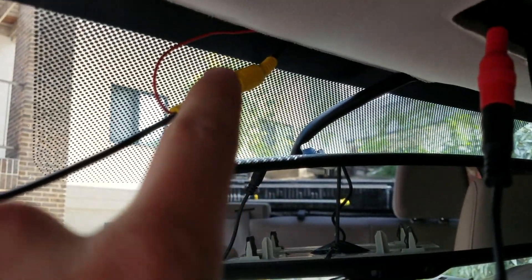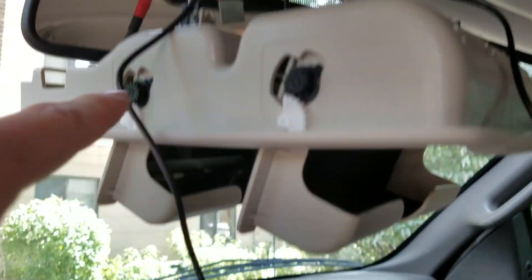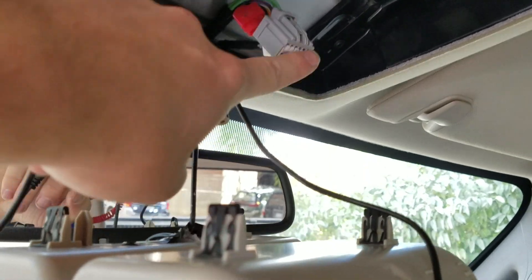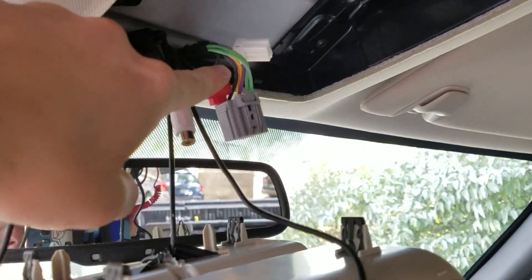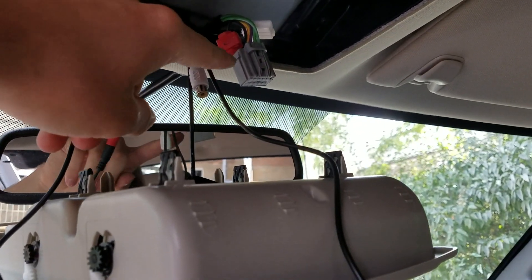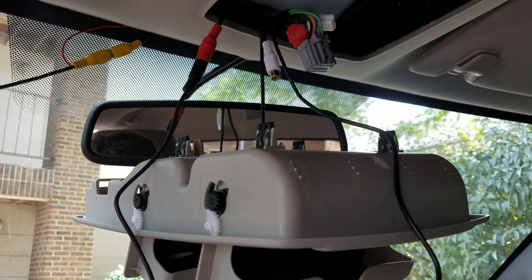Just a quick recap: we have the video output connected, the power is over here and connected through to the screen. We have the grounded connector with the black wire. This is for an extra piece like if you had a rear sliding door or a sunroof, but I don't have any of that. I could have found power with that and powered the unit, but it wouldn't turn on and off with the reverse lights — so that's why I use the reverse lights instead. Now it's basically clean up this wire system, put this part away, and then test it out and make sure it all works.